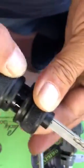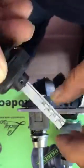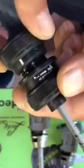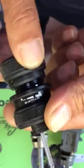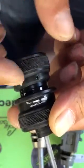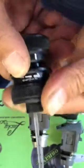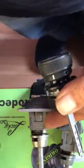If you want to use that tool for the ignition lock, discover the orientation of the ignition, insert and pull back, and find the position only by giving tension, losing tension, and finding the position of that line. Somewhere in that sector you will turn the ignition also. Or you can manipulate it directly if the door is damaged or something.